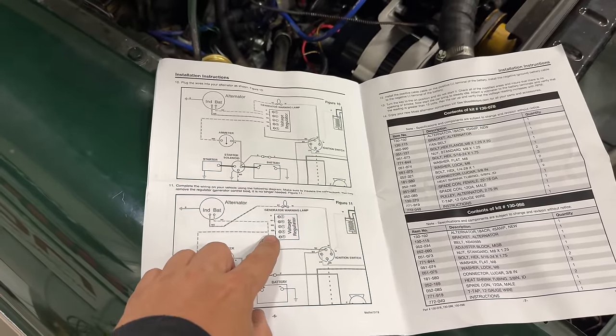My last must-have reliability upgrade is a new Pertronix distributor. For less money than this new distributor, I could order just a Pertronix unit and put it in the existing distributor, but that distributor is probably all worn out. Putting a Pertronix unit inside of a worn out distributor will never be as accurate as replacing it with a brand new distributor. In preparation for the new distributor, we want to do a couple of things — these aren't really necessary, but this is going to save you a lot of time if something goes wrong.